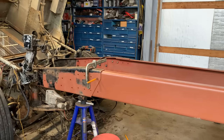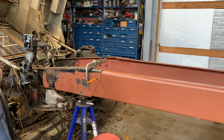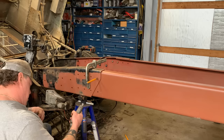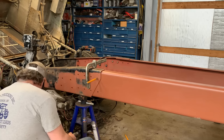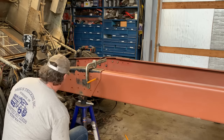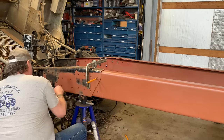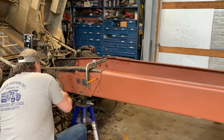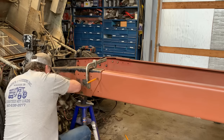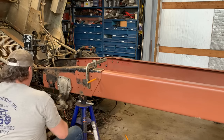All right, we got our bolts. Let's put this spring shackle up, and then once you got six bolts in it, after you done drilled it, it ain't going nowhere. Now obviously, oh yeah, look at them holes, they're perfect. Man, I like it when you do it right the first time. I painted the back of this bracket even. Hopefully this one goes up a little better than that other side did, because I got the jack in here. I can kind of manipulate it. I'm hoping better. We'll find out.